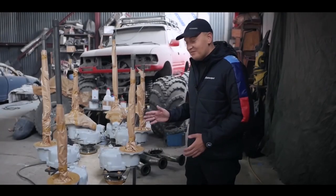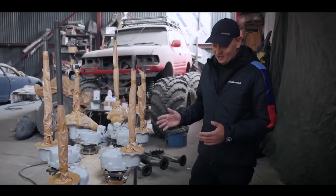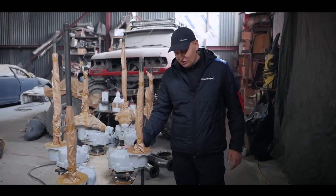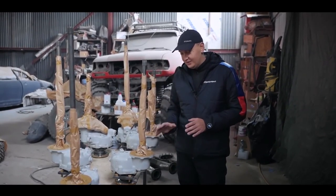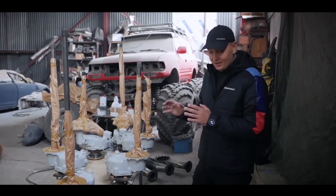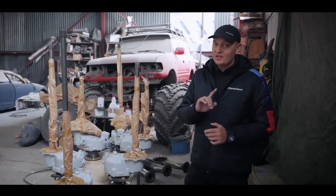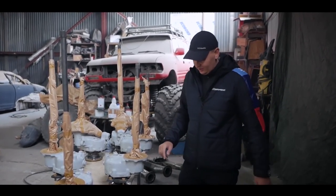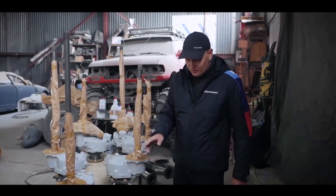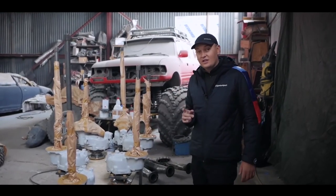These are our final drives. They are the most precious element in the G-Wagon. This is clearance, there are big wheels, this is power. Our final drives are all new and after an inspection. We made the inspection before, in a video for our client, to assure him of their newness. There is no deception, everything was made according to the original. They are being rubbed down right now. We are going to prime the faceplate, also paint it with black polyurethane paint, and start installing on the axles.